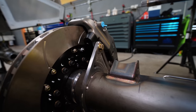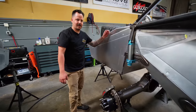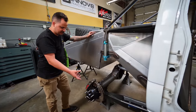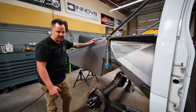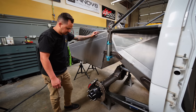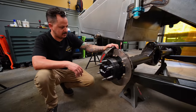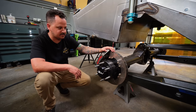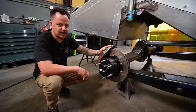We make this caliper mount for a Pro-Am six-piston and a Willwood six-piston caliper, and it had the same bolt spread, so I put that mount on there and the Brembo lined right up. We didn't have to design or make any new caliper mounts — we have a box of those things already made, so that made it pretty easy. The other side is done as well, we just don't have the caliper on it yet. Next up we'll get these mounted on the front spindles matched with the front trophy truck hubs. This thing will have some serious stopping power.